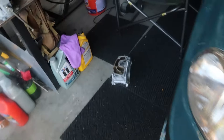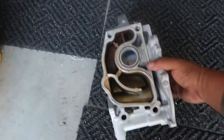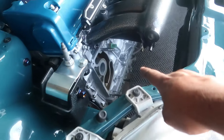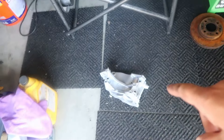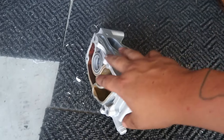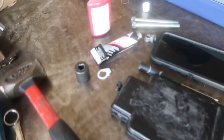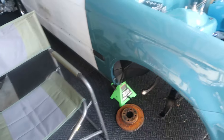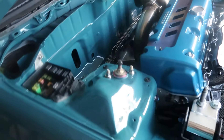So I did put some stuff in and made a little bit of progress just to keep things moving. I put the manifold back on — the turbo manifold is on. I ended up painting the water housing so that it matches with the block since I painted that too. I'm going to go ahead and put some Honda bond on the seal so we can get this tightened up onto the block. Little by little we're just making a little bit of progress while we find those knuckles.